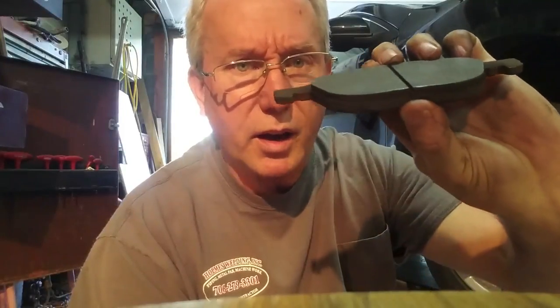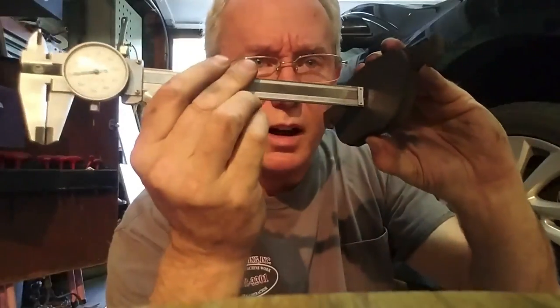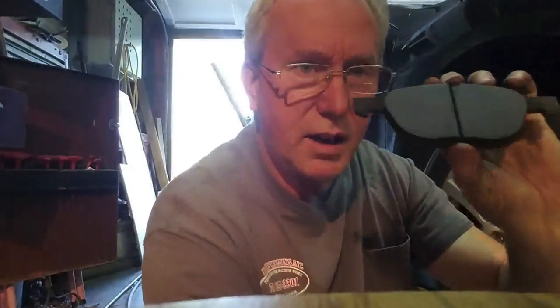I'm just changing the brake pads for the first time. Look at this — I still got plenty of brake pad on there. I measured it with my calipers and I've got a little over a sixteenth of an inch left in that groove. I'm not one of those people that ride with their foot on the gas and the other foot on the brake. Those people are wearing out their pads fast — probably changing them metal to metal at around 40-45,000 miles if not sooner.